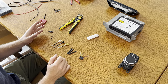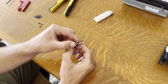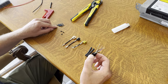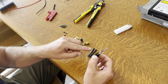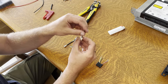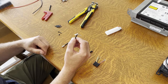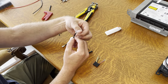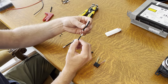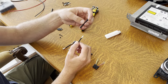Before we start repairing the cables that have been cut, we have to prepare them. We've cut the cables to the right diameter and length in order to get the right fit in the car. We prepared some heat shrink for the cables, which we need to attach before soldering. The FM/AM cables consist of three parts: first is the core, which we solder to the car side, then we isolate it from the shield, and then we solder the shield to the car end as well. We wrap that up with new heat shrink, and then attach another layer of heat shrink over the outside before we start soldering.